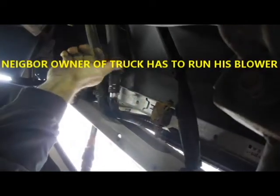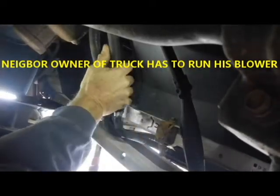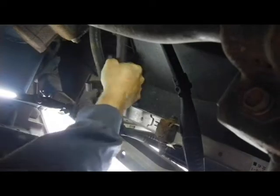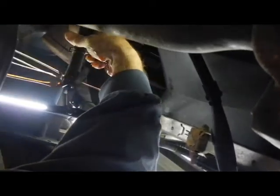Removing the hose from the cooler — it has one snap-style clamp. You've got to be tender here because this is nothing but aluminum, and it's cold out today and the rubber is cold.